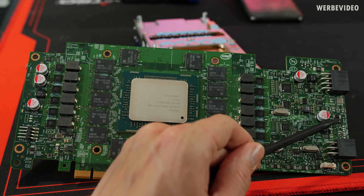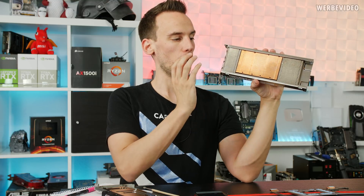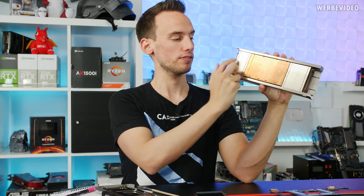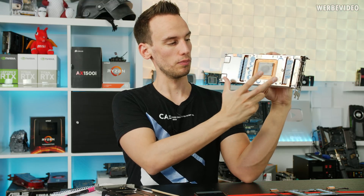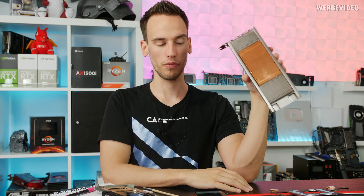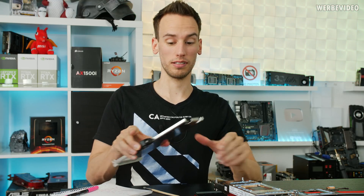There's one more temperature probe on the right side for intake heat sink temperature, plus PWM controllers for voltage regulation. Checking the heat sink: the center part is made of copper and contacts the CPU itself, while the left and right sides have aluminum fins connected via heat pipes that dissipate heat from the memory chips and VRM. Thermally this is quite a challenge - dissipating 300 watts in total. Compared to a 2080 Ti it doesn't have a much bigger heat sink but has higher power consumption, so you can imagine this thing is not easy to cool.